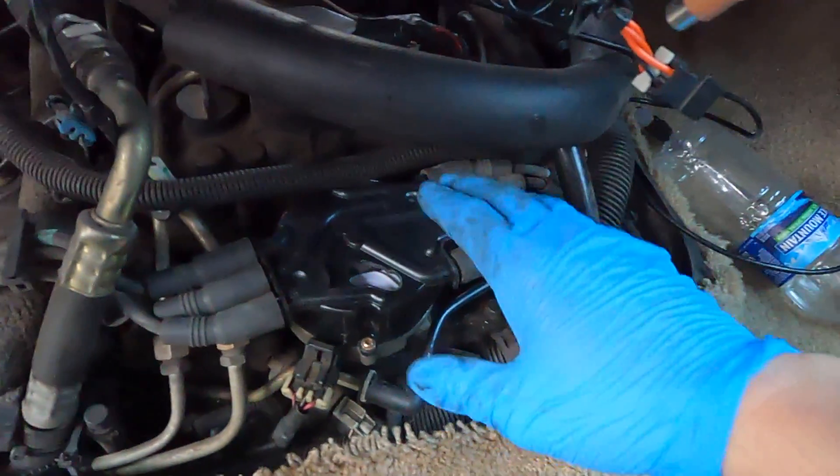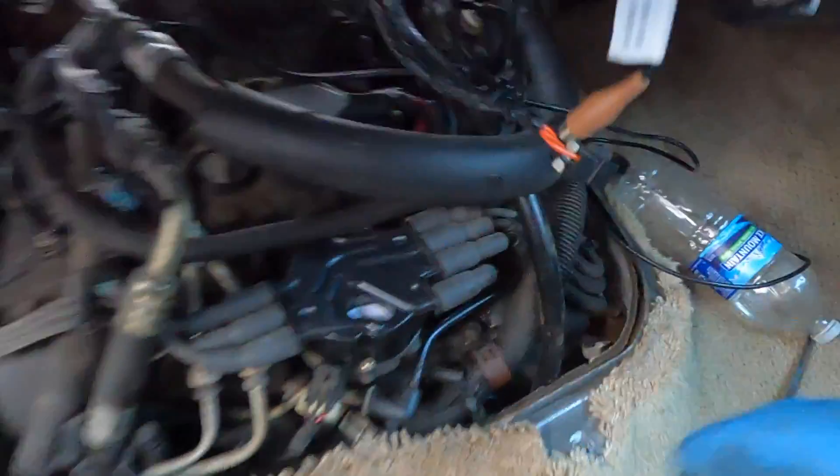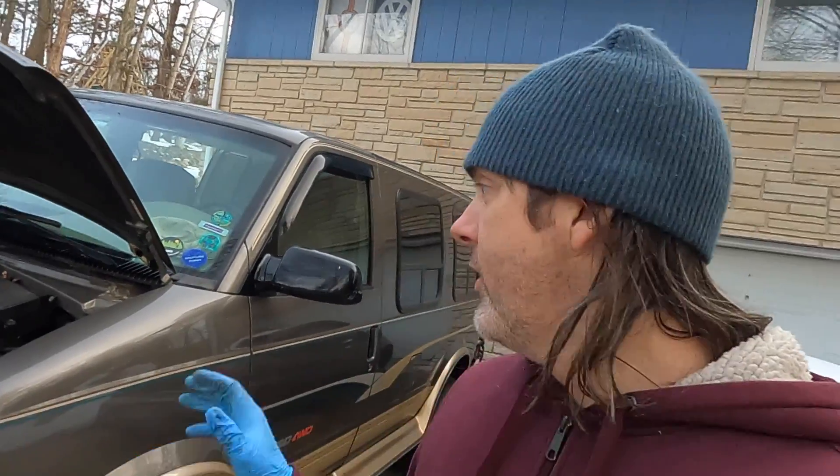Now we're going to remove this cap with the hole in it and put a fresh cap on here and tighten it down — hopefully I don't need to look at this thing until I do a V8 swap. We're going to seal the bottom edge of the distributor with dielectric grease to prevent water from running down the side of the cap and coming inside, and we're also going to put some dielectric grease on all the contacts inside and wipe off right where the spark is going to happen — hopefully that will prevent corrosion from starting on those posts. You guys saw that video — the spark was this long, and now it's like nothing, just from clocking that distributor.